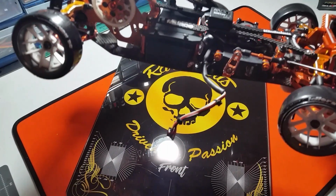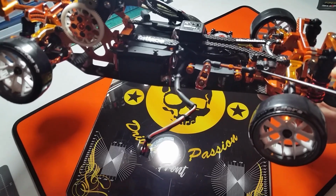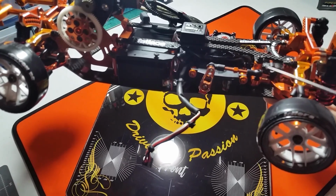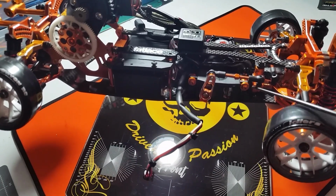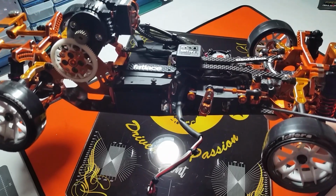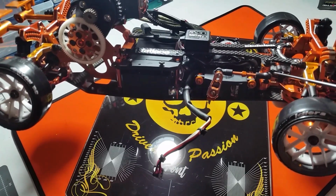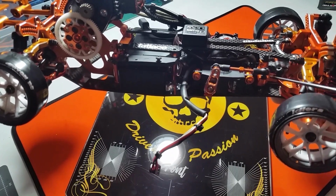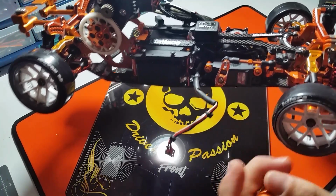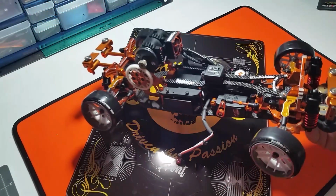And another thing, on the rear wheel drive kit, they eliminate the rod that goes up to your upper chassis plate. So get a couple of spacers, a long set screw and a nut, and drive that down and put your spacers in. That will eliminate the play that you're getting in this arm, because eventually you'll start getting wobble in this arm, even with it tight, because its only connection point is at the bottom. So keep that in mind, guys. Get some spacers, a set screw, and a nut. Drive that down, take the screw out of what's in this, and then replace this with it. Just get it snug enough to where she still does what she's got to do. But now you don't get that unnecessary wobble. Again, that wobble will come up in your gyro, and you'll get that speed wobble on your car.